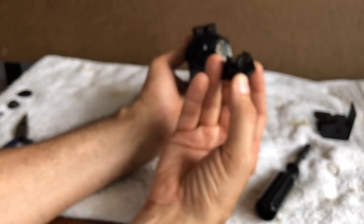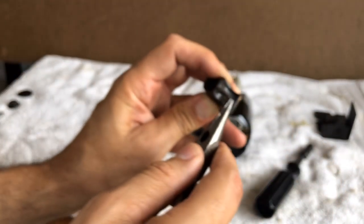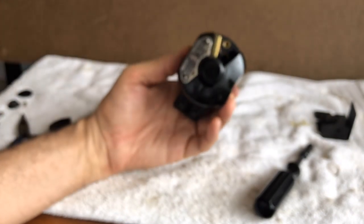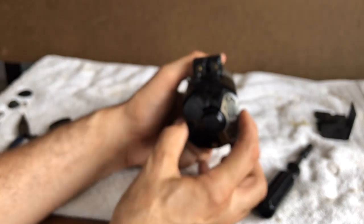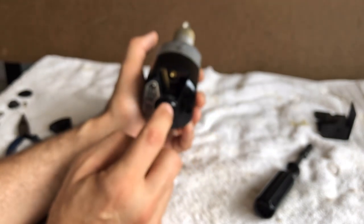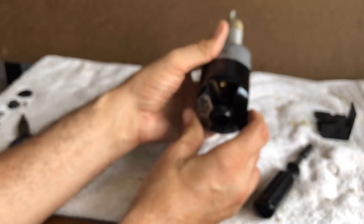I'm taking this little piece off — be careful not to lose the attachment bolts. There's something stuck on the edge here — it's old grease. For whatever reason, somebody put grease in there. Grease doesn't belong here. This may be close to the bearings, and that could be part of the source. Sometimes with these motors you will see a grease port — it looks like a little chrome tube sticking up — but at some point Singer did away with that. This is a housing for the motor where I believe these use grease and not oil for this bearing.